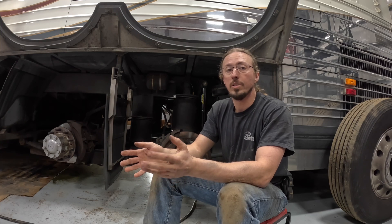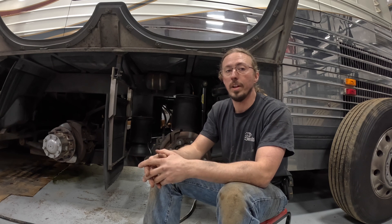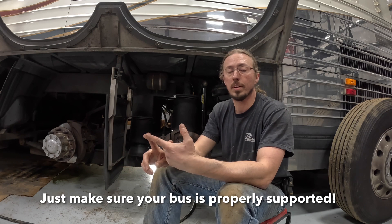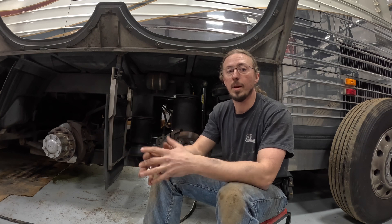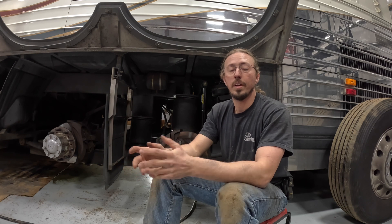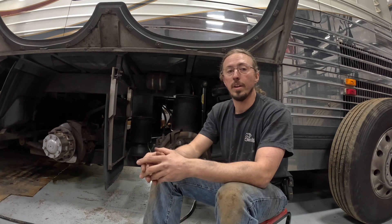I hope you found this video useful. Draining the air tanks is really simple to do, but it's one of those things that often gets overlooked, and it is an important preventative maintenance item. There's no reason why you can't do it yourself — it definitely doesn't require any tools whatsoever. The only thing I'd recommend is having some rubber gloves and shop towels to catch any mess from residue that may come out when you drain the tanks. Let me know in the comments any questions you have, and if you'd like to see more preventative maintenance videos. Thanks for watching.